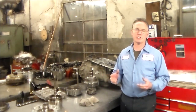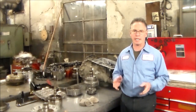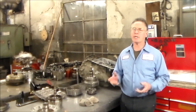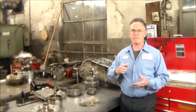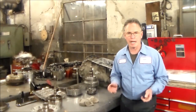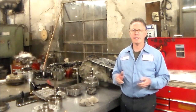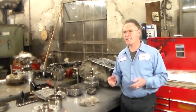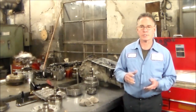I figured out a price, just kind of to do a repair for him, because the transmission actually worked okay in all the gears, except when it got hot. On a 3 to 4 shift, sometimes it would run away, put it into limp mode, and then you get the E-clutch monitoring code.